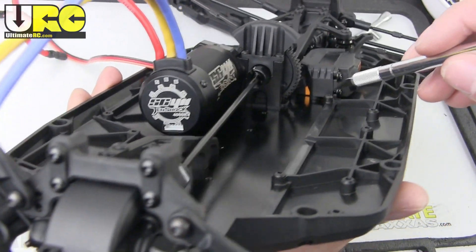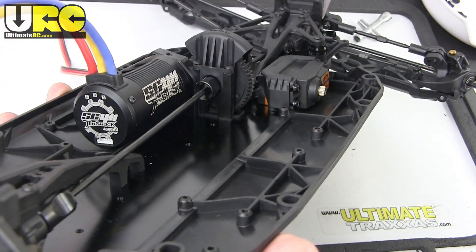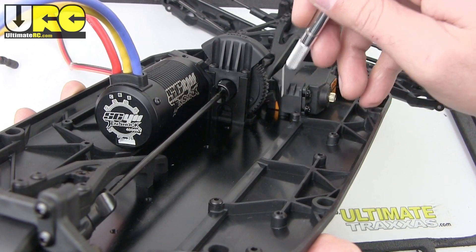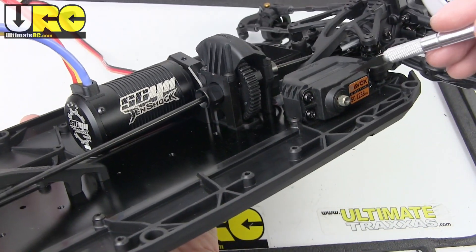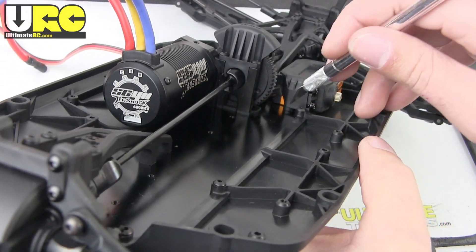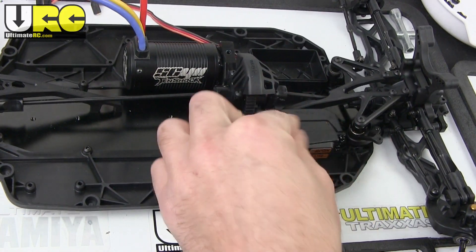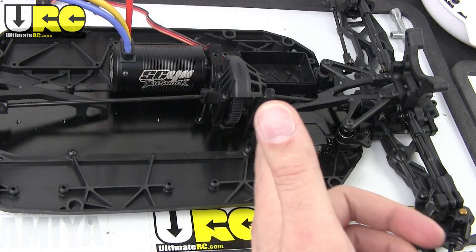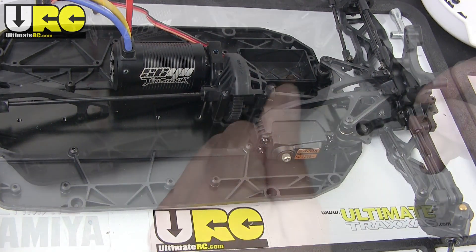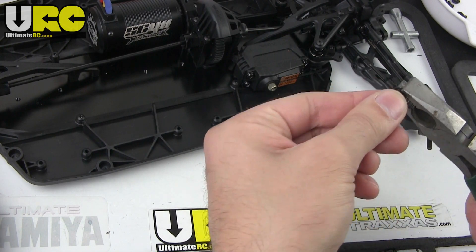When I tighten it down it didn't quite work as it should. There are two screws coming up from underneath and it's symmetrical front and back, but there's a slight gap and angle because there's not enough spacing under the vertical post — the servo body rests against the plastic guard. You might want to add an extra spacer here. Savox servos are the same dimensions as Futaba and very common, so they should have tested this mount with one. Also, the drag link turnbuckle barely threads into the ball ends at all — I don't appreciate that.